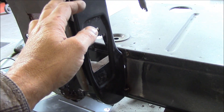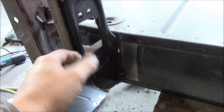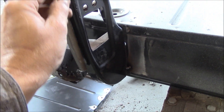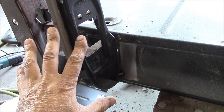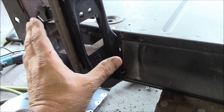If the opening changes a bit, it's better if it gets wider than if it gets narrower. Because if it gets narrower, now you're really screwed — what are you going to do? You're either going to peen back the edge, or start peening back the door, or start cutting the door, which is just a grief. But at least if this ended up a little wider for the door gap, you can always weld a thin piece of metal in there and do your bodywork — you've solved the situation. Don't panic.